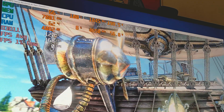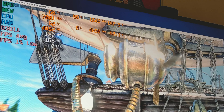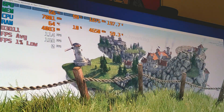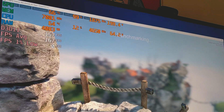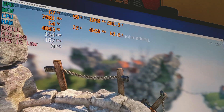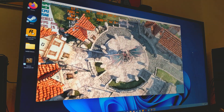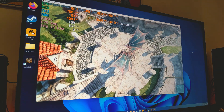For our GPU, we're averaging just under 1900MHz and pulling just under 200W, which is pretty good so far, but we should definitely be able to push that a little higher. With both our temperatures, we've got a decent bit of thermal headroom for both the CPU and the GPU. So I'll run through the benchmarks, get some results to compare, and then we'll get to tweaking some settings.